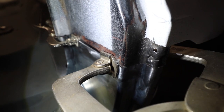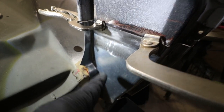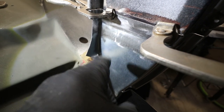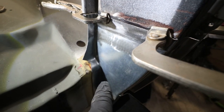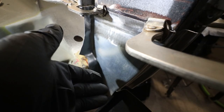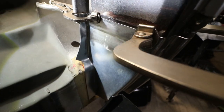Wow, I got to say, this fits great. The next step is to grind both these surfaces down and get it ready for weld. As far as this panel goes, this is galvanized — you do not want to be welding on this stuff. It can cause some serious flu-like symptoms and could possibly even give you black lung. Definitely want to remove all the coating. So I'm going to, just to be safe, remove it all the way down. My plan is to put this in the blasting cabinet and get it completely blasted and epoxy the other side before I do the final welding.